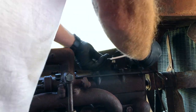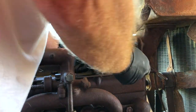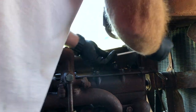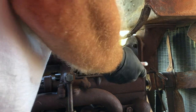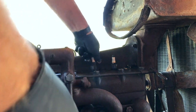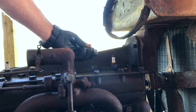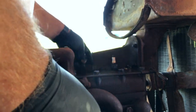These of course are the antique-style plugs - they can be rebuilt, which is very cool. The reason I'm removing these spark plugs is so I can get some penetrating liquid down into the cylinders, because the motor is seized up. I want to get some PB Blaster down in the cylinders, let that soak for a day or two, and then we'll come out and try to unseize the motor or at least be in that process at that point.